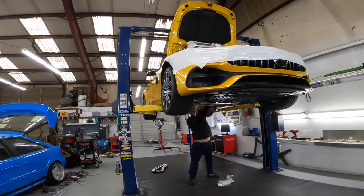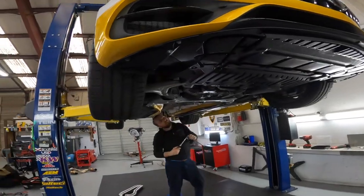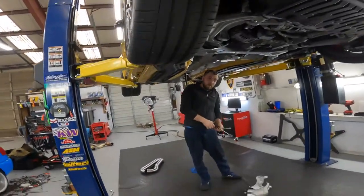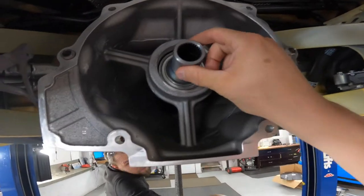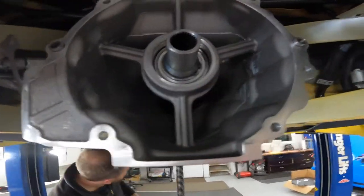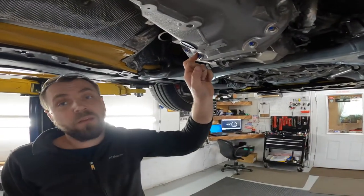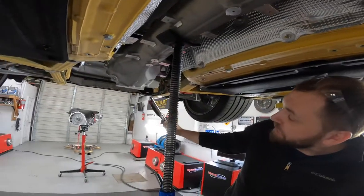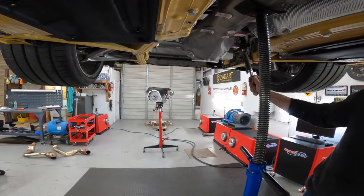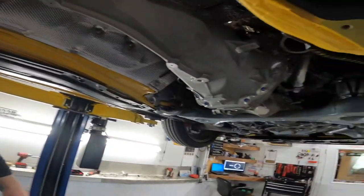We're slowly putting it back together — it's a process, you've got to make sure everything is finessed since this is such a new car. We got the tunnel and drive shaft in — it's a carbon fiber drive shaft. First specification for this aluminum bolt is 20 Newton-meters and then 90 degrees. Same bolt for the bell housing to transmission — 20 Newton-meters and 90 degrees. That's our plan to install the transmission back.